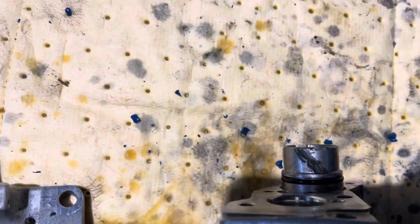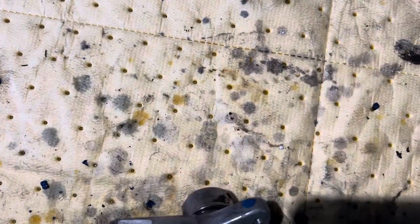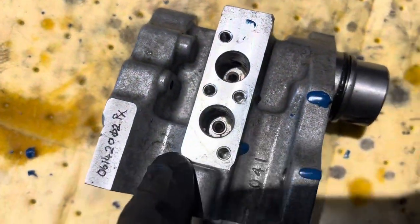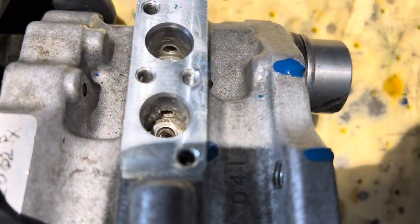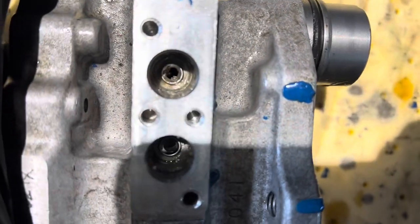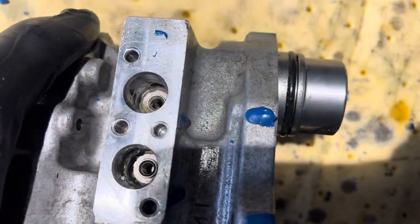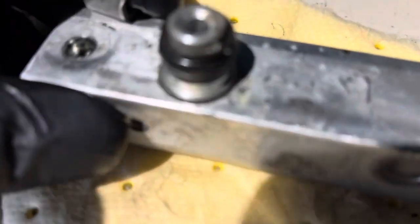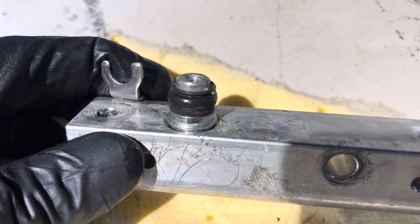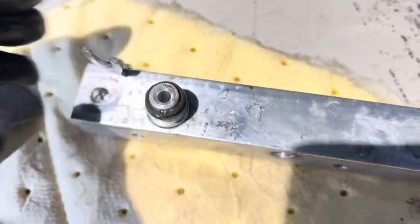You need to take these out. There's a spring in here and a ball, and that part comes out of here — there's a ball in there and a spring. Look at that nastiness that's just in there. You've got to clean this out. You can send it out to get it done, but it's not rocket science — it's just some screws. You take the screws loose, clean it out. Look at that — see all those deposits in there. All that's blocking up your fuel system. It's a high pressure pump and there's a lot of screens, little filters.